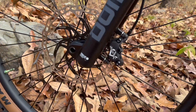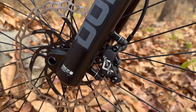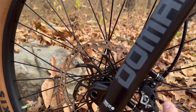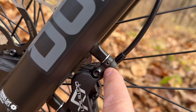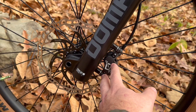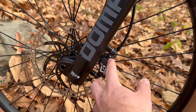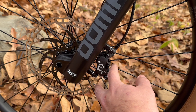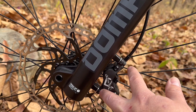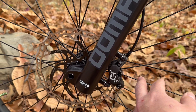So I just put these on — these are the Dominion A4s. I'm going to make a video on those. What I love about these A4s is you have these adjustment screws here and here on the post mount. You basically take them off all the way, snug these bolts here, and then you adjust these screws where they hit the Allen nut there, and then you make sure that they're centered with the rotor, and then you torque these.